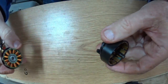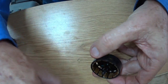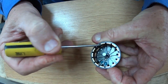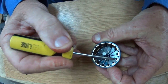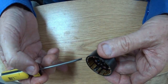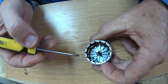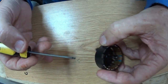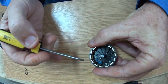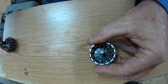Same deal — inspect the inside and make sure there are no magnets come loose. They're all looking pretty good and well stuck in there. There's just some rust in there that we'll need to get rid of, but we'll give that a clean up later with some oil. I'm suspecting these little bits of blue goop visible in there are probably to balance the motor — there's no other reason for them to be there.